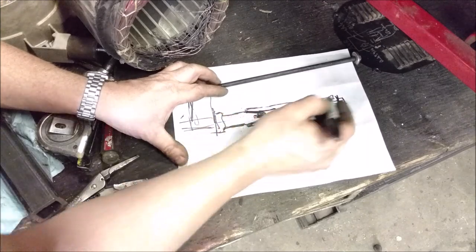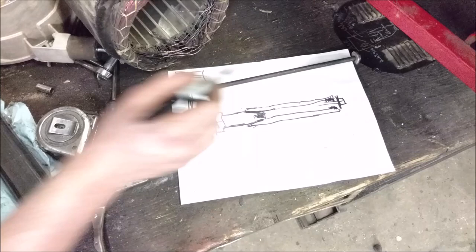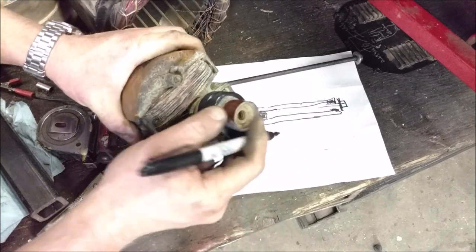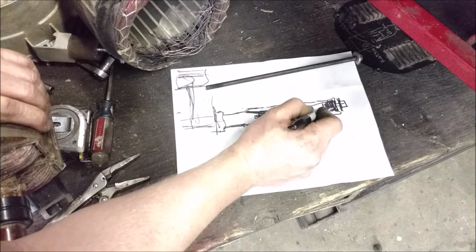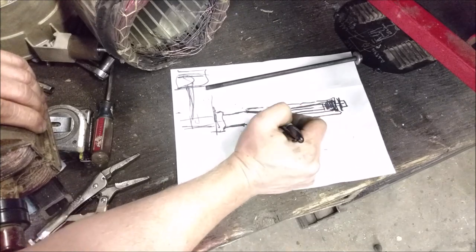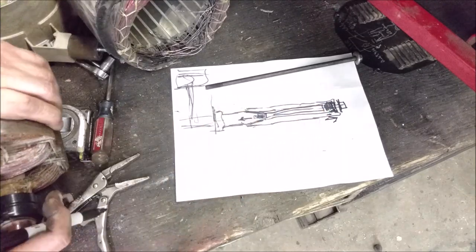The way you get this off is to pull it off the taper. The easiest way is to get a shorter bolt — some of them actually come with threads on the end of the rotor, though this particular one does not. What you do is get a shorter bolt that only goes in so far, then jam a bar right in there of that length, and as you turn the bolt in it's pulling the rotor this way and pushing the shaft the other way.